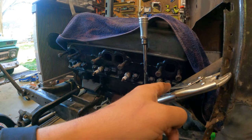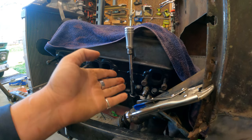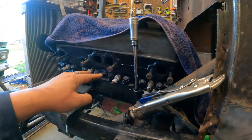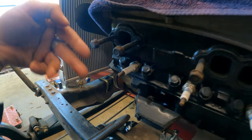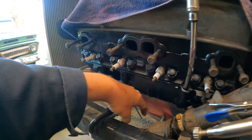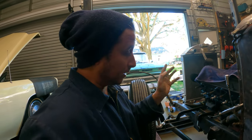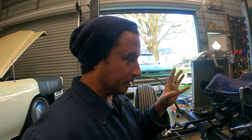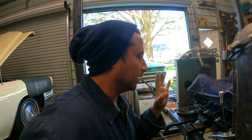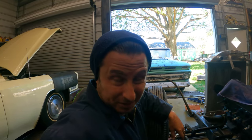This definitely eliminates the idea of the rear dump exhaust. That's gone, so we have to go with a center exhaust. I don't think a front exhaust is gonna get us anywhere either. So we need to leave this area clear for exhaust. Why? Because every other area is taken. Lake pipes would still work, but I want the option to run a hood and all the other stuff. So until I decide, center dump exhaust. Have I said center dump exhaust yet?